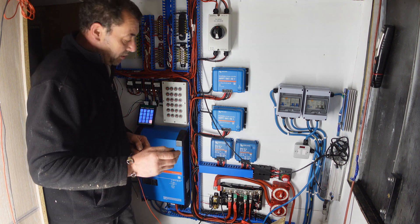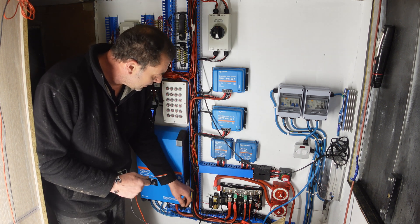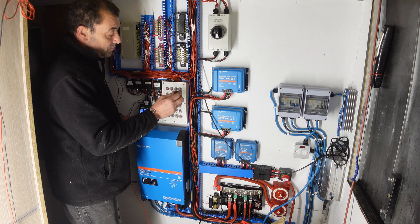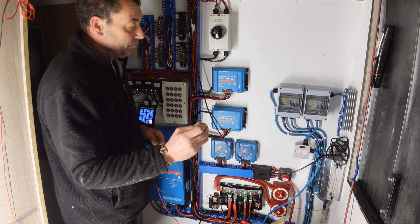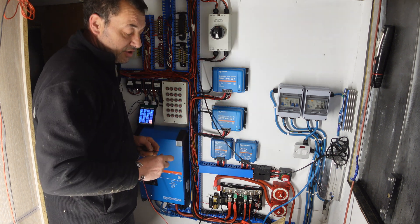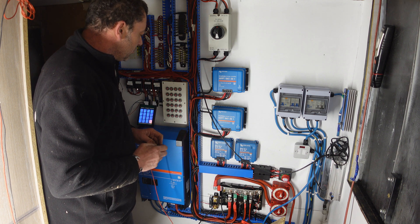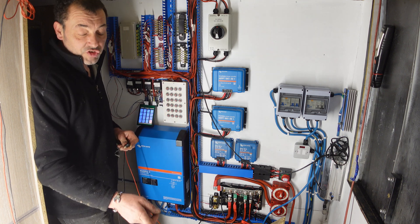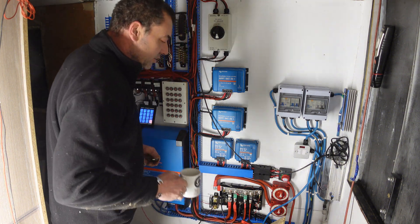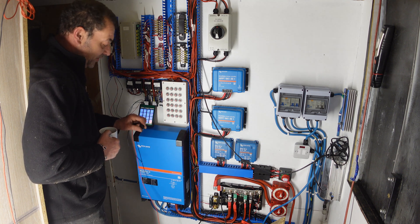What I'm going to do is just run one cable up, and I'm going to put a little on/off switch with an LED light on it. So if the LED's lit, it's trickle charging to the start battery. And if I don't want it, I can turn it off — because basically it is using power from the lithium setup. There's that much power there it should be alright, shouldn't be a problem, but if there is — I can turn it off. So that's what I'm doing.